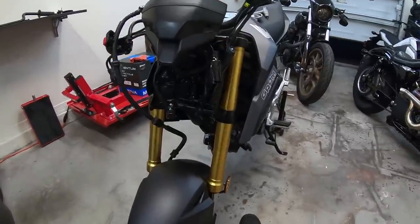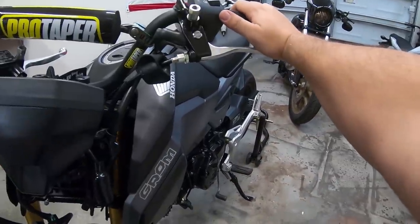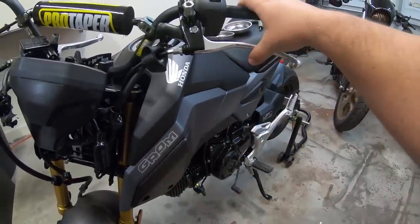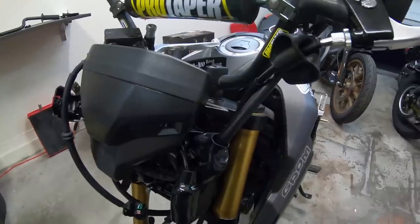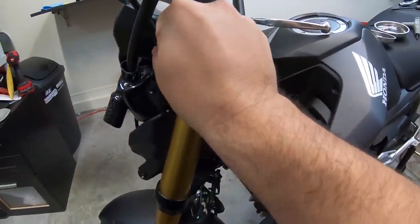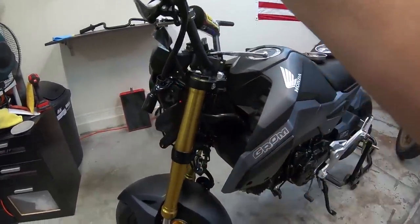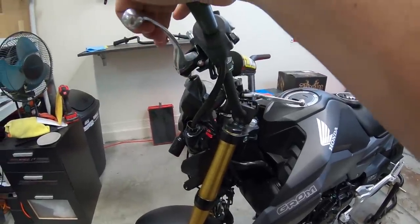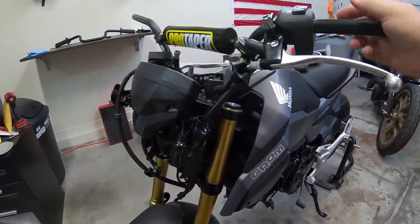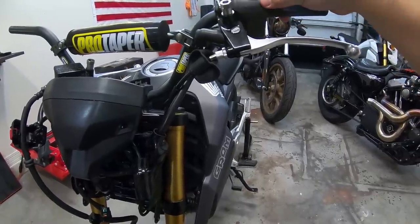Quick update — got this pretty much set up. I took it off the stand, did full tilt left, then tried to rock it in first gear and it won't rock. When I pull the clutch in it moves. At full tilt, the clutch cable tightens up quite a bit, which was worrying me — but rocking it wasn't pulling the clutch cable either, and pulling the clutch lever engaged the clutch. So we are good for clutch at full tilt left and right.